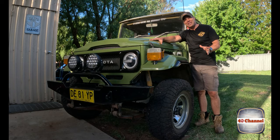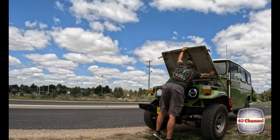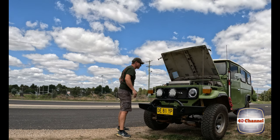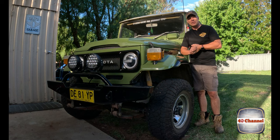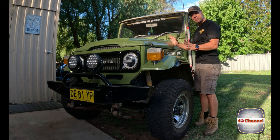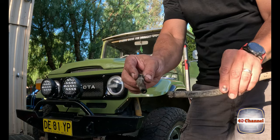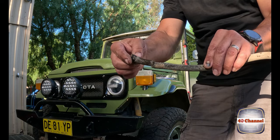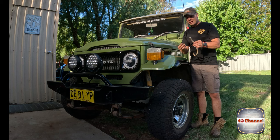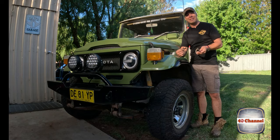Truck drivers and a whole lot of other guys all jumped out of their cars and trucks, pushed me off the side of the road. Got it started again, got it home — coughing and spluttering all the way thinking what's happened, brand new electronic ignition, what's going on? It felt like it was starving for fuel. I pull it up here — fuel line. A broken fuel line, a little bit of fuel line tucked right up under the chassis that I hadn't seen before. It goes from a hard line to a hard line and it was cracked right there, sucking air in and making all sorts of issues.